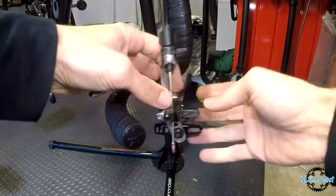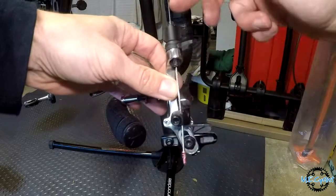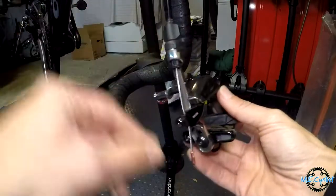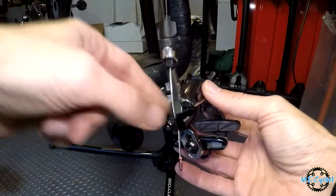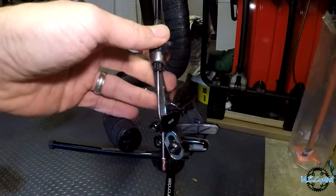What I'm going to do with the brake cable is just take the cable off because I can't cut the housing shorter with the cable inside. I'm going to pull the nipple off, then slide the housing out so I can pull the cable out and cut the housing shorter. That'll all make sense in a minute.